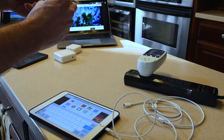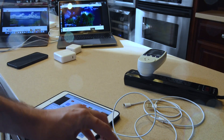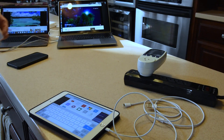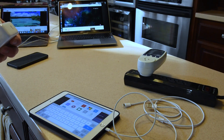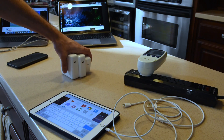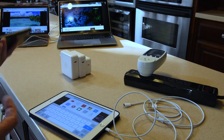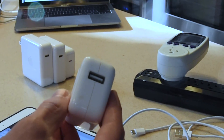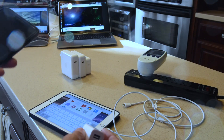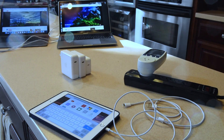In summary: the USB iPad and iPhone chargers, both 5-watt and 10–12 watt, will charge every device here if you have the right cables. The USB-C charger family will also charge every device under the sun. Pretty much every device will charge with every single one of these chargers at its full stated rate — the exception being the iPhone, which charges faster on a bigger charger, increasing charging capacity by about 50%. Everything else runs at full capacity regardless of how you intermix chargers, which is very nice.